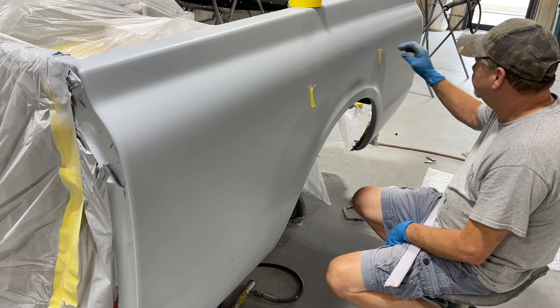So there it is — I had to wipe it. I wiped it with metal glaze finishing putty because it's such a thin layer that's going to be on there. Most of that's getting sanded off. I sanded it with 180 and applied the filler, so that'll get blocked down — there'll be a super thin layer to fill in that little bit of void that we had. It looks like a lot but most of it's coming off. Seems like a good stopping point — catch y'all next time. Block on.